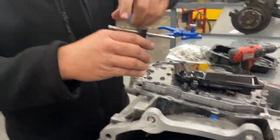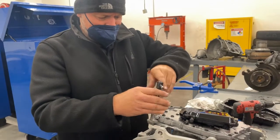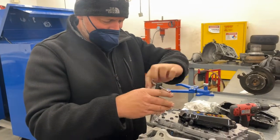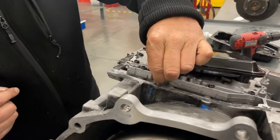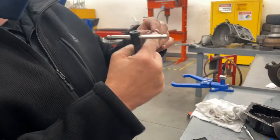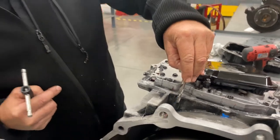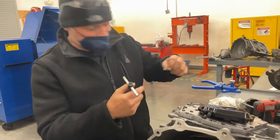You just want to go until it bottoms out and stop. A good rule of thumb: if it's a bolt where the bore bottoms out, take a screwdriver, stick it inside, and measure how deep it is. Then on your drill bit, put a piece of tape the same distance so you don't go too far down — because the last thing you want to do is drill into an oil passage. Put a piece of tape that marks the end of the bore.